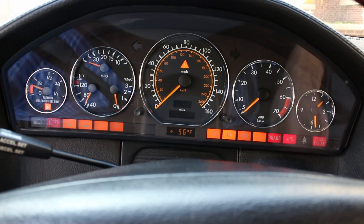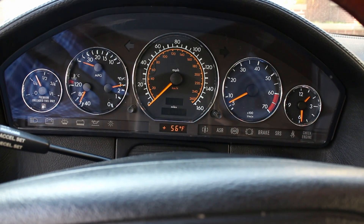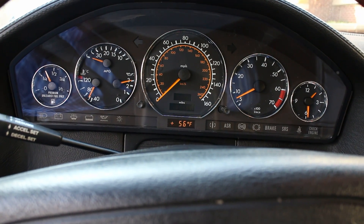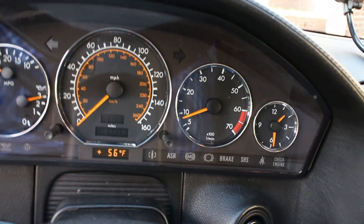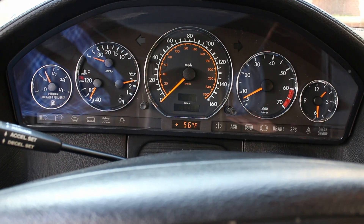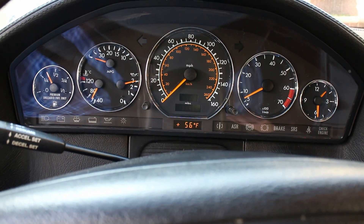Each and every time you start the car, the computer does a self-check on the throttles. If the throttles check out fine, it will not light up the ASR light and your engine will run on all 12 cylinders. As you see, we just had limp mode happening and now this is our normal acceleration — just tap on the gas pedal and it goes right up. No problems. This is how you can tell if your car is in limp mode or not. Right now the car is not in limp mode — no warning lights, perfect idle, acceleration is light and fast.